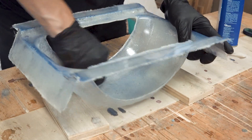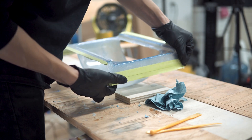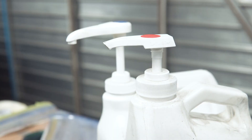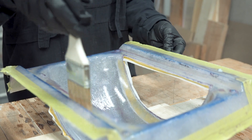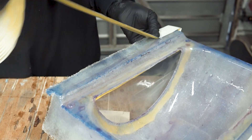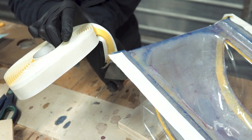Now that the mold was ready it was time to make the new fender. We started with a clean slate by wiping down the mold with denatured alcohol. Next we lined the edges of the mold with masking tape so the tacky tape could have a good place to stick to later. Then we brushed on a few thin layers of PVA, waiting 30 minutes between each coat. After mixing epoxy and hardener we painted on a thick layer into the mold, then lined the edge with tacky tape and cut the carbon fiber pieces to size.